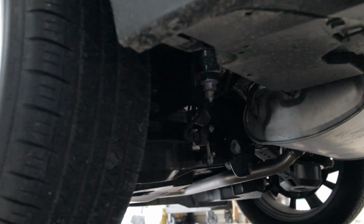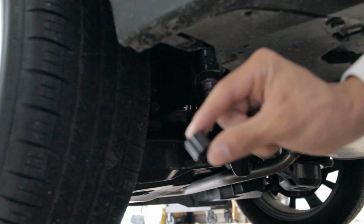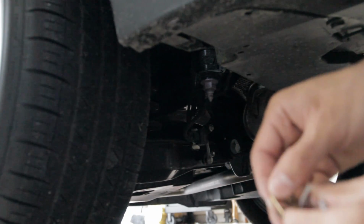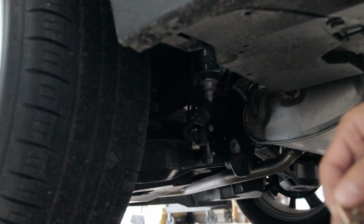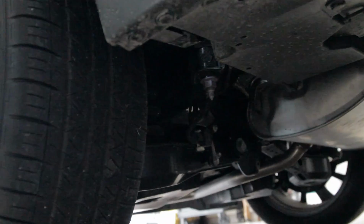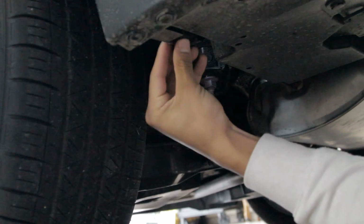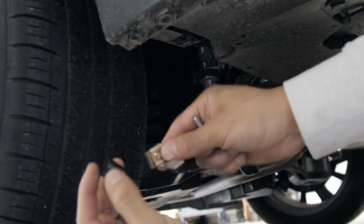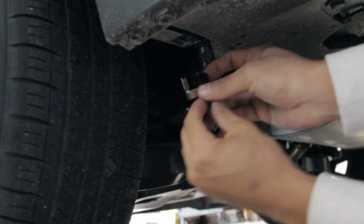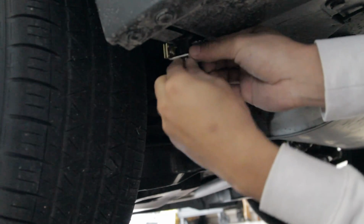Alright guys, for this next step, so putting that bolt in, what you're going to need is this insert push pin, the washer, the supplied L bracket, the little bracket for the L bracket, and your 1.5" screw, okay? So the first thing you're going to want to do is attach this gold little plate to your L bracket, okay? So first, we're going to go ahead and put in that replacement clip. Like that. Then we're going to take our spacer, our bracket, put the spacer on top like that, run the screw through the bottom, and that should just screw right in. Just get that started.